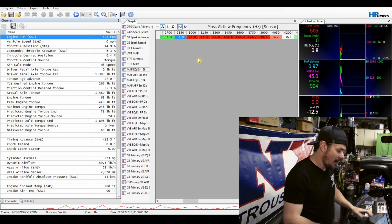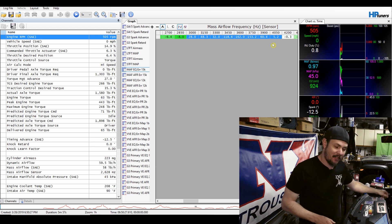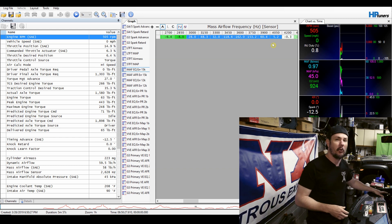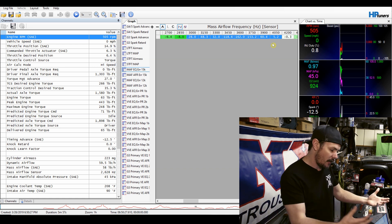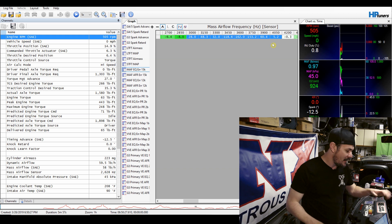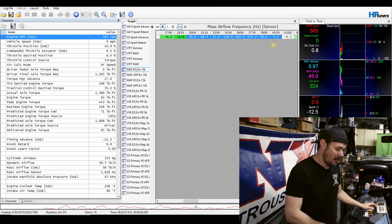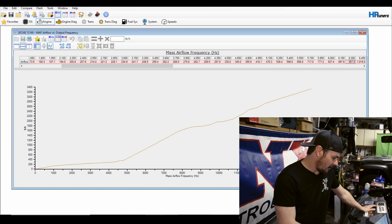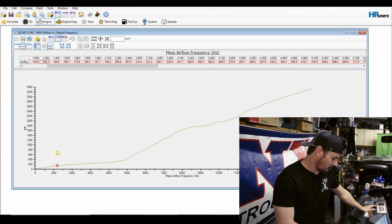We still do have an issue — a lot of what you're seeing here is going to be tied back to the bypass valve still trying to flutter. Surprisingly, where we're set up now we are always in vacuum, so the bypass valve never goes fully closed anymore. But just that fluttering of the valve is yet another thing causing air reversion — a surge of air and then all of a sudden it drops off. As far as the mass airflow sensor is concerned, it's almost as if the motor stops breathing air. We're seeing the frequency drop down to 1,800 Hz and even 1,350 Hz, which is just right on the cusp of not even running as far as the MAF is concerned.